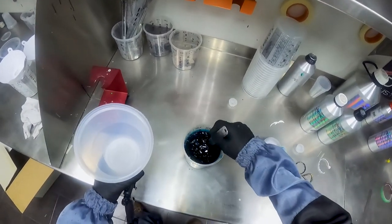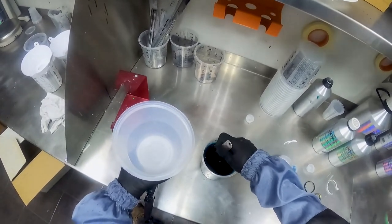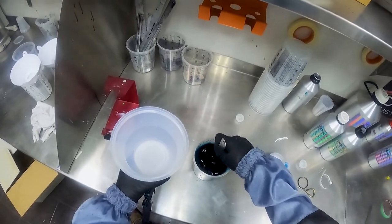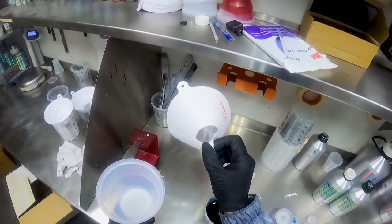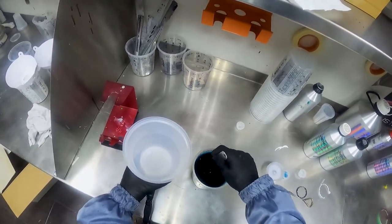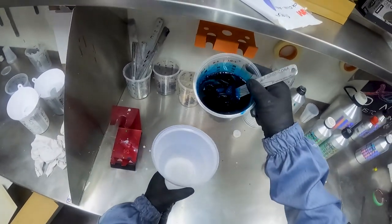We'll just double check that we stirred that. I don't remember stirring it. So that's why we use a special candy filter. If we were to use a normal 190 micron filter, like I showed you up here, the seeding will actually go straight through that and will not get caught by the filter. So just a bit of an in-house pro tip: when you use candies, make sure you use a candy filter. So we'll pour that in.